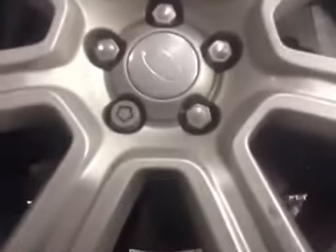Engine and gearbox look good, no leaks, in the green. Offside front suspension looks good also, in the green. Offside front tire is down to 6.7mm, which is in the green. Offside front brake pads are down to 10mm, which is in the green. Also, the offside front brake disc is in good condition.